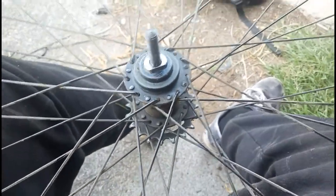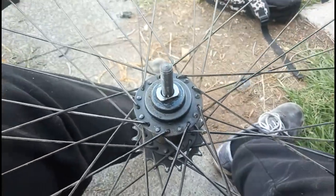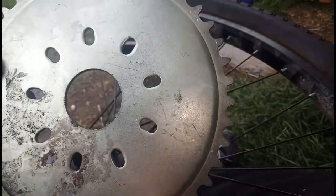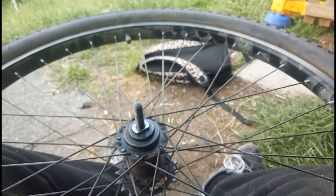The coaster brake arm is off, but this does not fit over the dust cover. I've got two options: I can remove the dust cover and risk exposing everything to mud, grime, dirt and nasty stuff — or I can go find the sprocket I originally ground out for the Mark 4 to fit over the massive Nexus 3-speed hub dust cover. Rather than grind out another one, I'm going to go find that and we'll get to work.